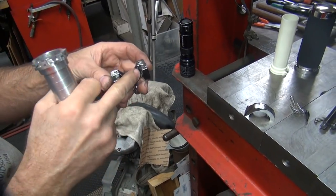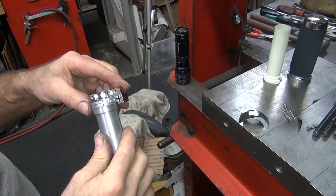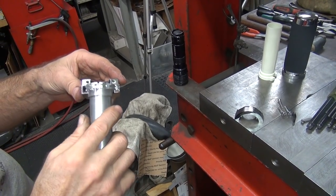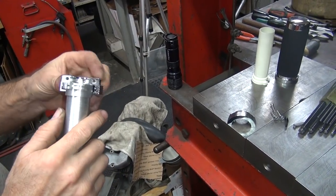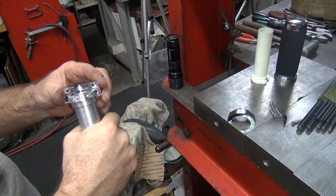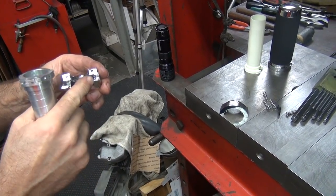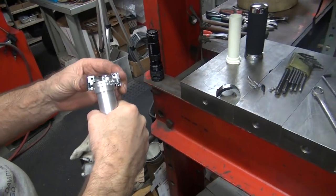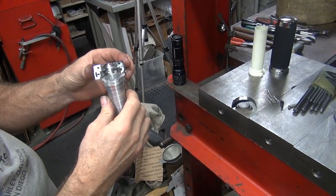Well, your throttle stop is only hitting against this edge. That's all you get for a throttle stop for idle. How far it comes back. That's the problem with these things. Not much that way. This way here is a pretty hard hit. This flat surface against here is a hard hit. Boom. That works pretty well wide open, you got a good hit, but going backwards, you go past that when you go down to the next one. The plastic ones, you hit the top and it shears that off, you go to the bottom and it shears that off and you go further down, it really jams in there. You got like 15 different stops in the damn thing, they're all locked up, they only work freely right in here. So you just got to deal with all this stuff.